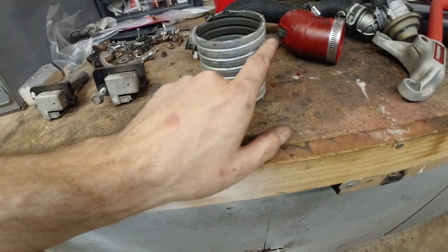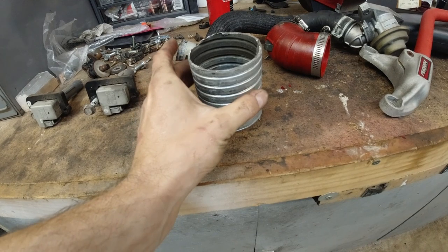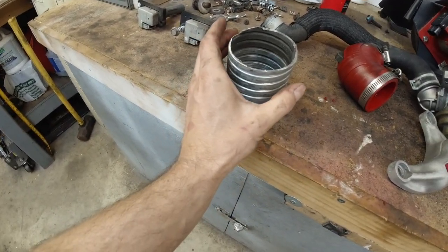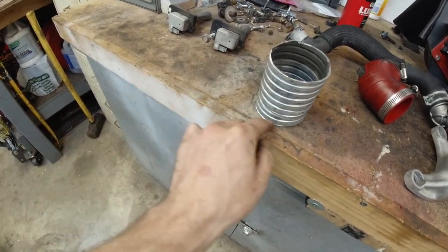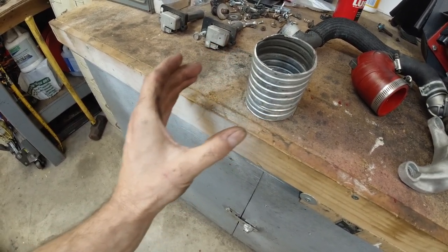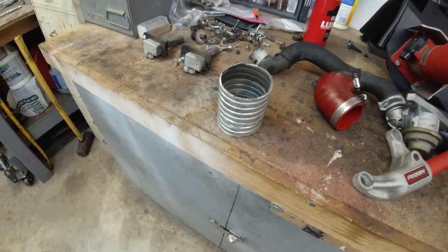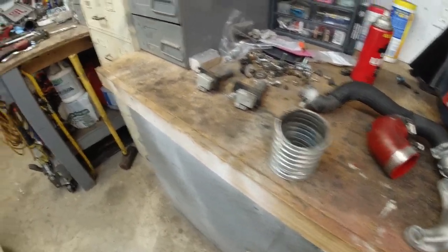And I've seen where a buddy of mine actually had an 07 and the piston, once we took the piston out, just one of, I believe it was number four, this whole piece, like a C, broke off in between the rings and just came out when we took the piston out of the block. It was the same kind of symptoms that my car is having right now, which is quite a bit of oil consumption and low compression.